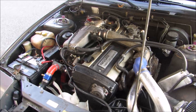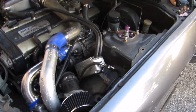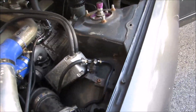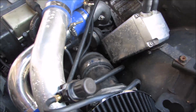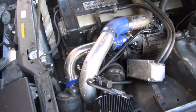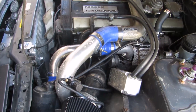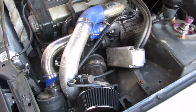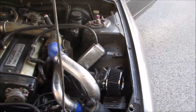I got total compressor surge, hit boost cut, and it was just scary. So immediately I turned it down. I turned it the other way and that's when the boost started to be restricted by the controller. It's really annoying because there are a bunch of different little clicks. From what I've read it only controls 10 PSI, so you can only add 10 PSI to whatever your stock wastegate pressure is. To find the proper PSI within such a large range of clicks is really annoying. I'm pretty close now - I need to back it off just one click because I'm spiking like 15-16, so hopefully it'll be set at 14. I had it at 12 before but brought it up two clicks.